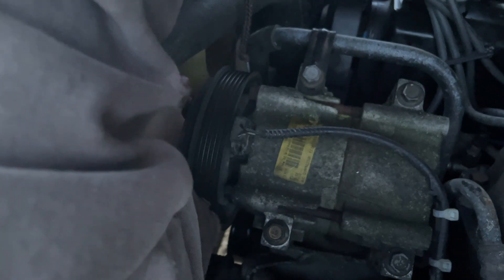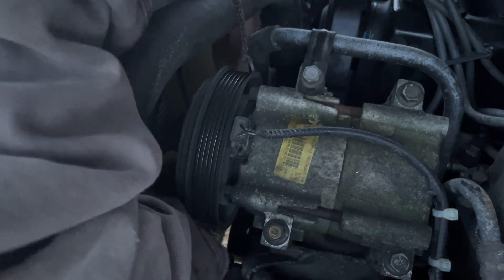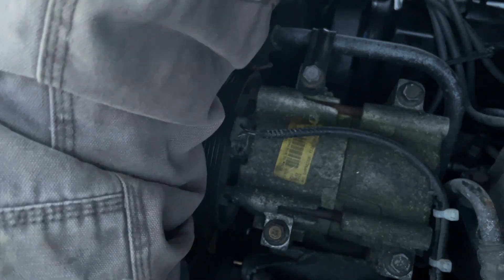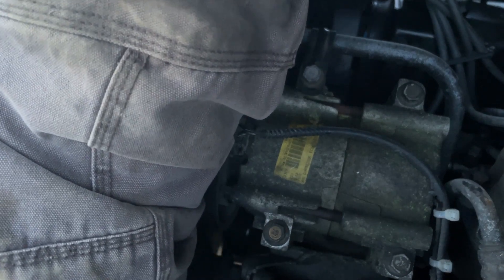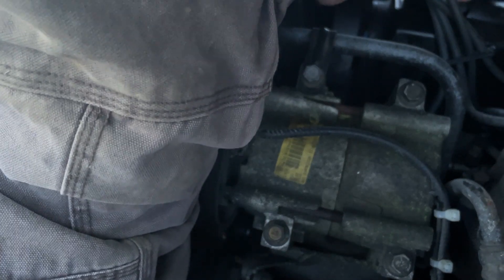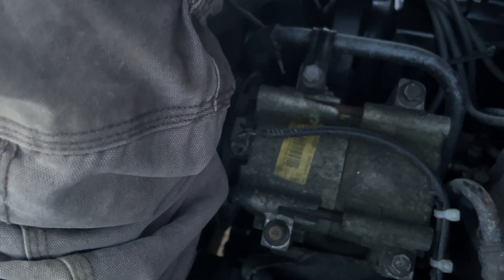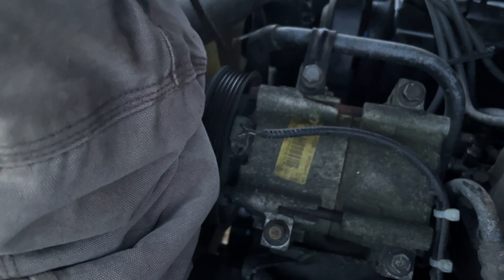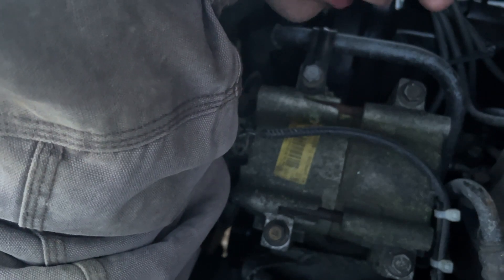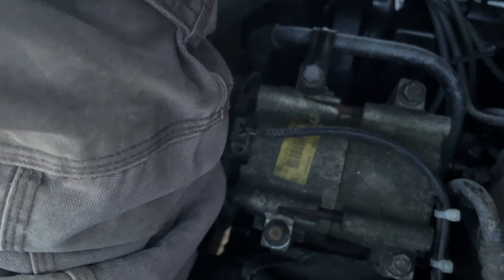This one's probably due for two belts because it's at 200,000. We've owned the truck since it had 124,000 - had I known, I would have changed the belt back then. We've got our belt around our fan blade and a routing chart on the front of the engine on the radiator core support that tells you which way to route the belt. Start at the bottom of your pulley system, which is your crank. Crankshaft pulley goes first, then right to the tensioner. Flats are on the back of the belt, ribs are on the front - as long as you remember that, you'll be good to go.